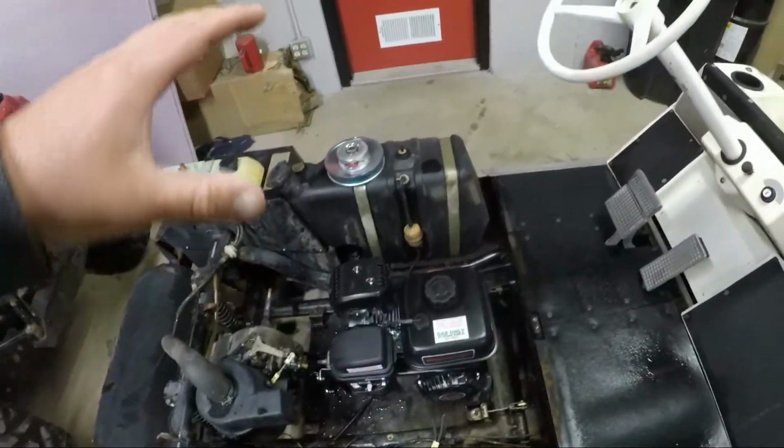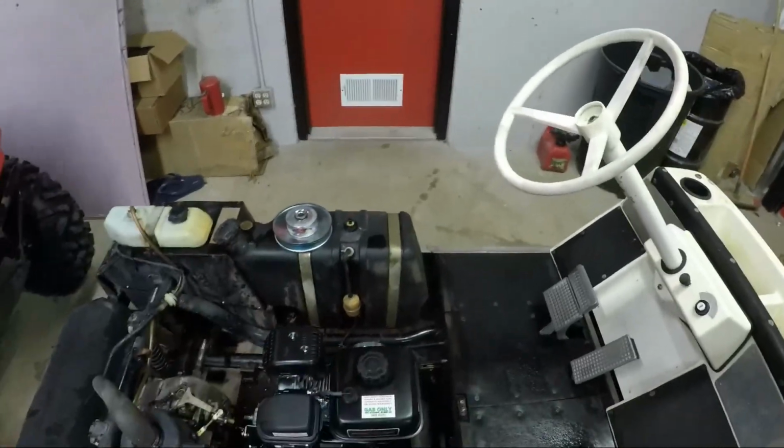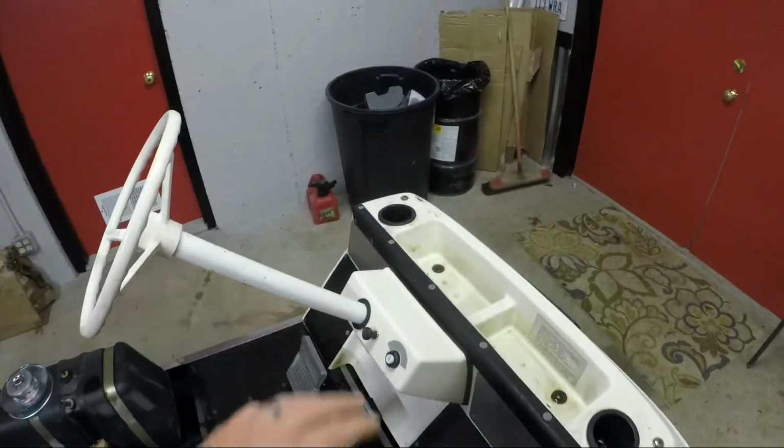It is going to be a little heavy towards the driver's side, but actually one of the other things I really want to do with this cart is the gas tank that's on the Predator. I'm probably going to get rid of and implement a fuel pump that pulls from the factory tank. So we will still get fuel from the big, what looks like a 5-gallon tank. Now, my thought process on this is it looks like we're going to be a little heavy towards the driver's side. But one of the other things I really want to do with this cart is I want to put headlights on it, tail lights, I want to put a stereo in it, some speakers, and eventually I'm going to get an electric start kit for this Predator 212, so everything will be driven off the key up here, key start with choke and everything else.